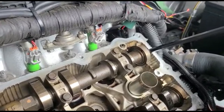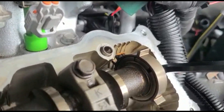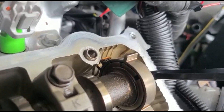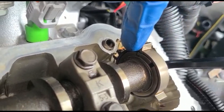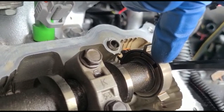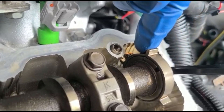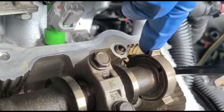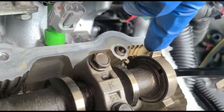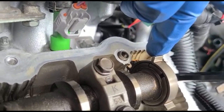If you plug the cam sensor in, the car won't start because it's not getting the correct information to the PCM. Right here is the trigger wheel from Nesformance with the dowel already done — you've got two slots: this slot over here and this slot over here. This is the OEM slot, and this is what you're supposed to put it back to factory. I just messed up and put it on the wrong one — it's a 50/50 shot. So check that out first before you go pulling timing and all that.